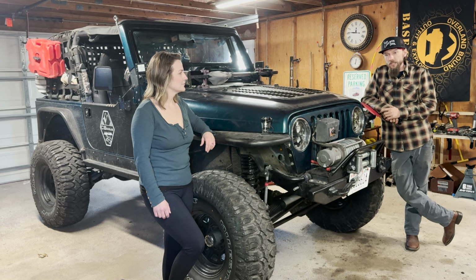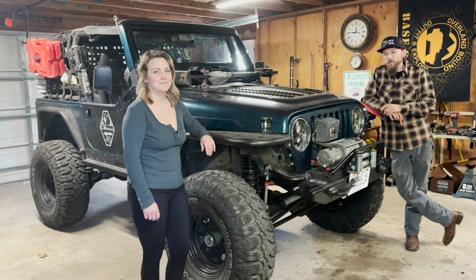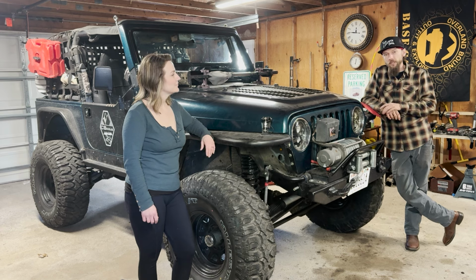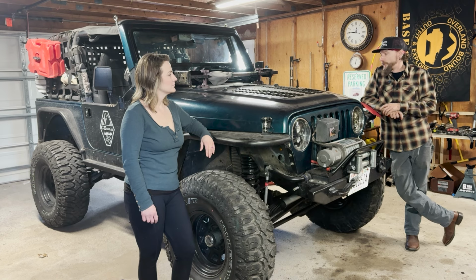So trying to address that, I found a company called Clayton Offroad. And through as much research and contacting a few different companies to find spring rates, Clayton has, from what I can tell, the highest spring rate, pound per inch, on springs that I've found so far. So that'll be the next set to go in here, at a 4-inch spring, and we'll see if we can get this thing to stay level.